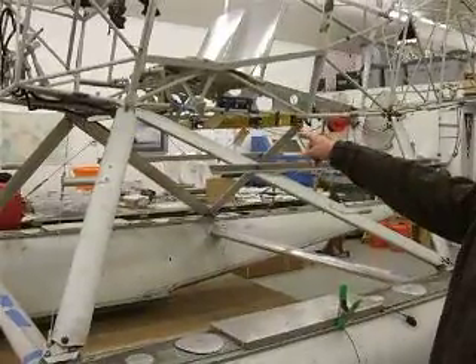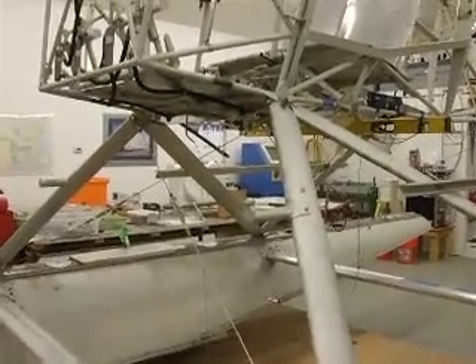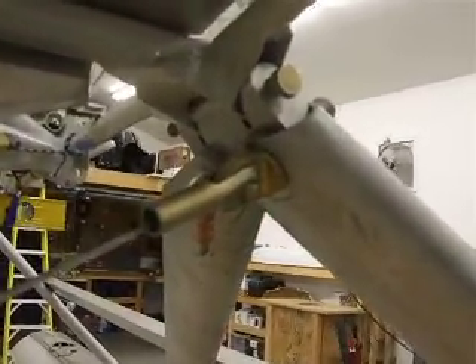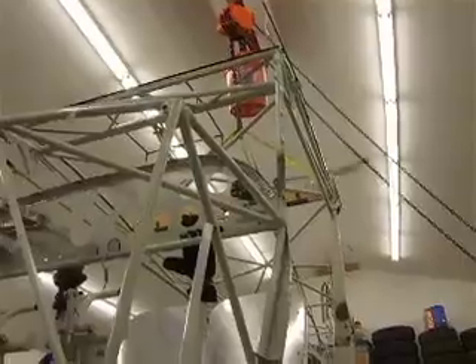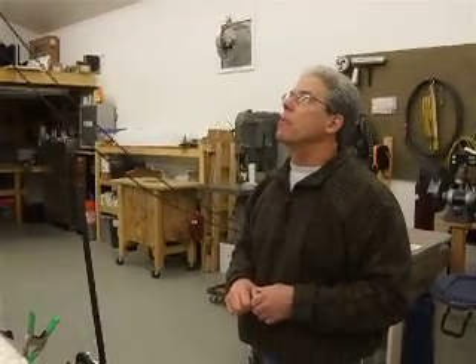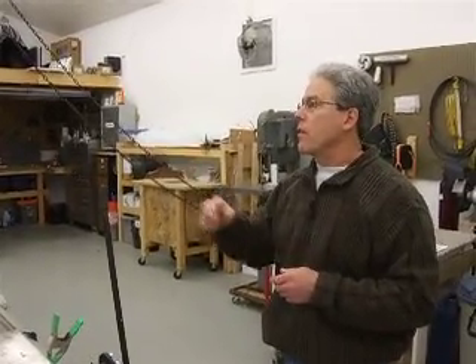The forward and diagonal struts are the same as the Cessna 180 and haven't been changed. Custom attachment blocks were made from 2024-T3 aluminum, kept as short as possible. Then the tail was raised and lowered to set the float angle relative to the centerline of the airfoil. Based on internet research, the floats should be 2 to 4 degrees down from the airfoil centerline, so they settled on 3 degrees and adjusted the tail stand to achieve that.